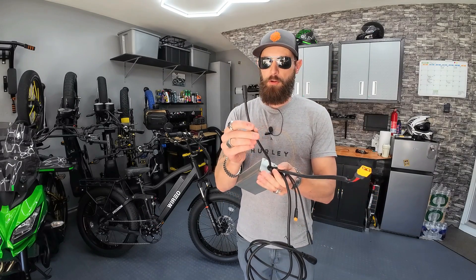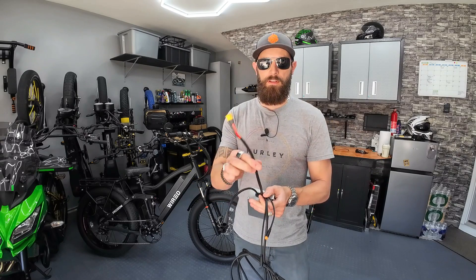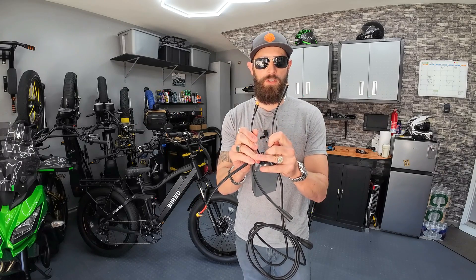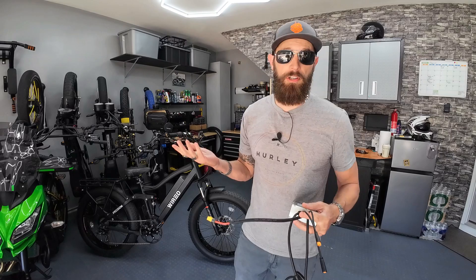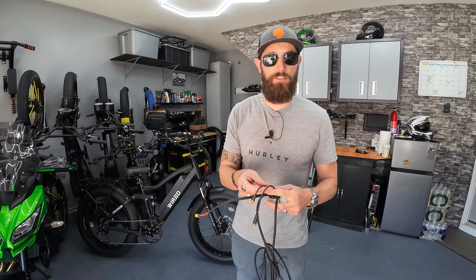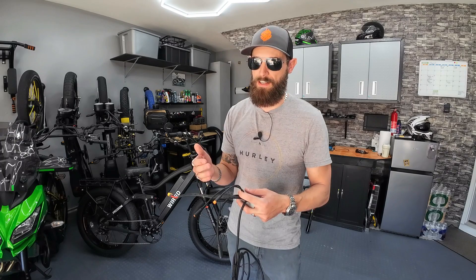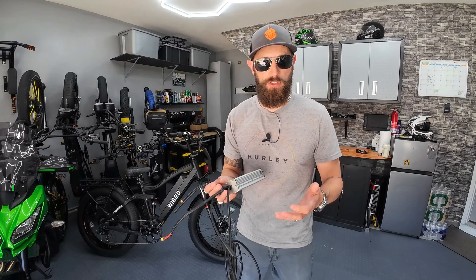This plug here goes to your main wiring harness that runs up to the display. This is the XT60 that connects to your battery. There are two orange plugs — one for a taillight and one for pedal assist. I don't include either in the kit. I don't know what taillight will be on your bike, so you can find a matching one if you want. For pedal assist, I find it really dangerous when a front motor of this power is connected to pedal assist — if you accidentally rotate the pedals, that front tire starts spinning and it's pretty dangerous. I designed the kit to be just a power boost for climbing a hill or accelerating quickly whenever you need it by punching the throttle.